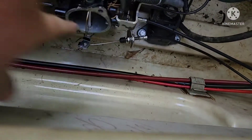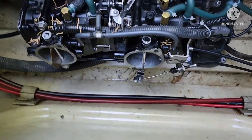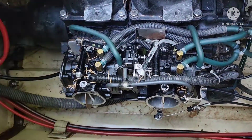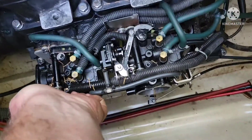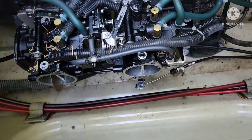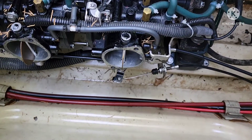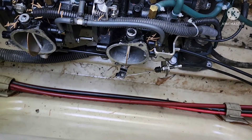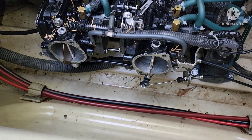The accelerator pump jets come through right here and right here — there's a little nozzle that sticks down into the venturi up in the top and sprays. You need to stick something in far enough to feel it. If you stick your finger in the right-hand side, you can feel that little brass nozzle — it's got a tiny little opening. Whenever you clean your carburetor, make sure that opening is not clogged when you do a carb rebuild.